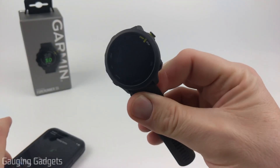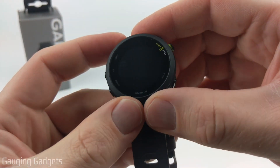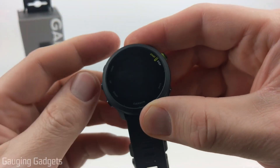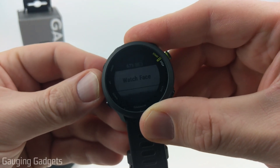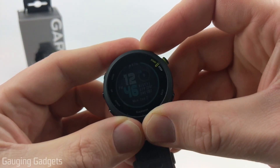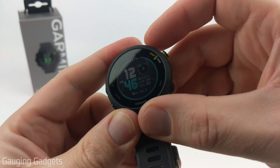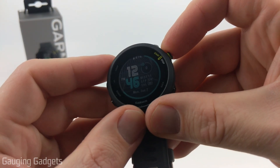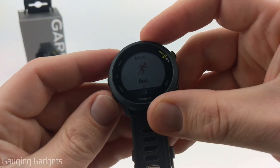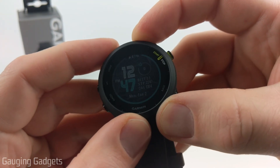When you go to your watch, you'll see that there is no watch face — this is an issue I've been having with the Forerunner 55. What I recommend doing to fix this is to hold the up button, then select Watch Face. This will force it to load that watch face. From there, use the start/stop button to select it, and then select Apply. That will apply it as your watch face, and as you can see, we now have this watch face installed.